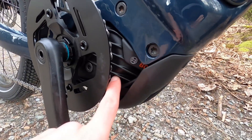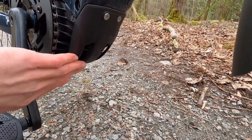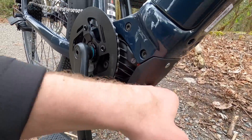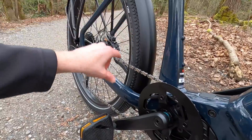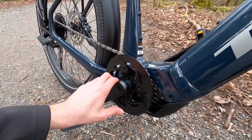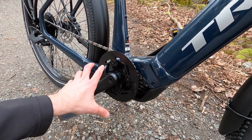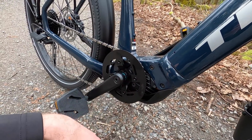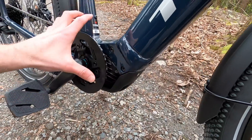There's a really nice motor casing here, with an aluminum alloy bash guard out front and the chain ring guard to keep the teeth intact. It doesn't cycle backwards — it just freewheels backwards. Apparently there's no extra resistance or conversion gears like the older Bosch motors, so it's a little more efficient. It's one-to-one coming out of it, and it's just well protected.